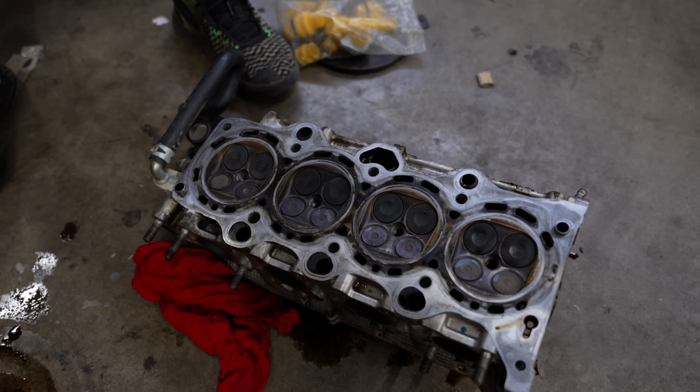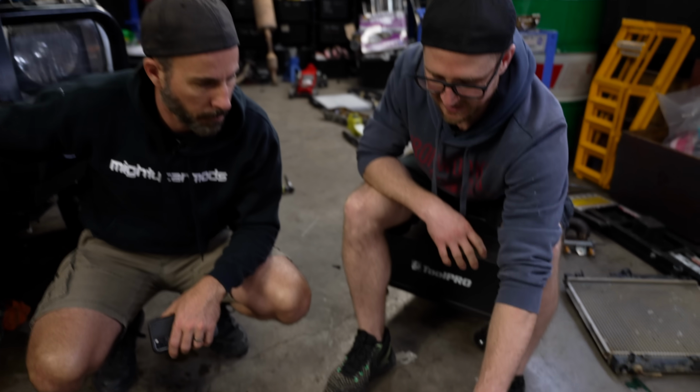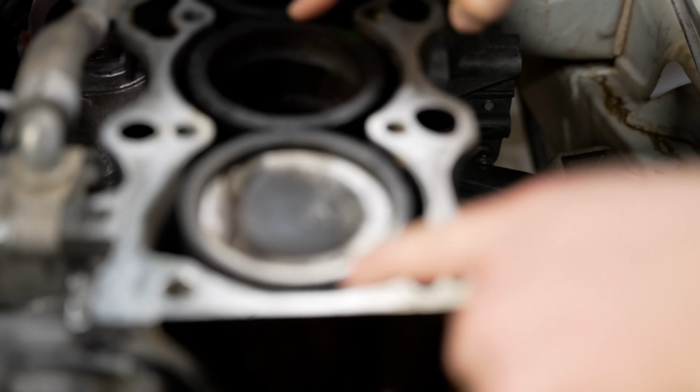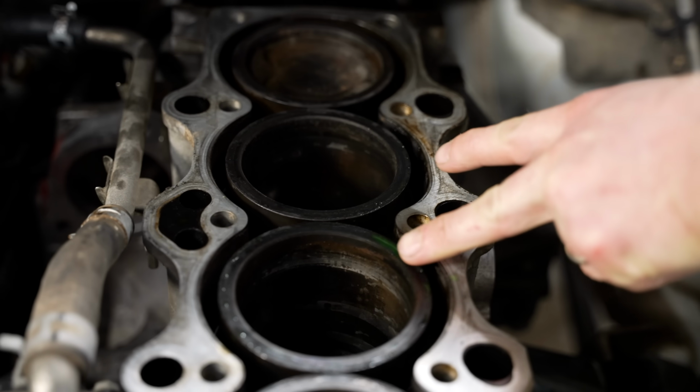Despite this hole though, like last night, I was reviewing our photos, that the head gasket wasn't sealing on the barrels. Yeah, because we knew that there was something wrong with number 4. But look in here. Look at the sleeves. You can actually see that there was only these small areas that were sealing on the sleeves. These 2 centre cylinders have been cooked.